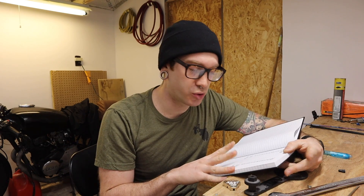And with this wheel it becomes pretty obvious what the problem was. On the non-drive side I've got three drastically different spoke lengths: two 282s, a bunch of 284s, and a few 285s. That of course would explain the broken spokes at the nipple, especially with those 282s. There weren't many problems drive-side wise — two different spoke lengths in there, 283 and 284 millimeter differences. My determination for the two different spoke lengths required is 285s and 284 for the drive side. As long as everything I source comes in at the actual same length, this thing should build back up into a very strong and reliable wheel.